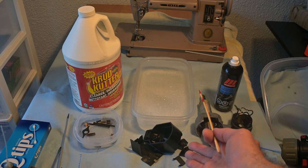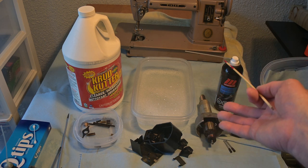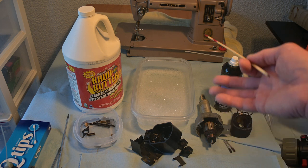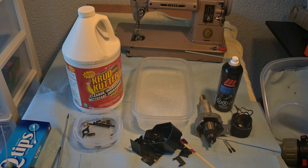Same for this gang of parts here — this is a lesser, less involved clean, one less step. It's just soapy water and then a clear water rinse from the tap, and certainly the hairdryer to prevent flash rust on that. So that'll be all three of them: the electrical clean, the bakelite lighter cleaner, and the heavy cleaner. That's where we're starting.